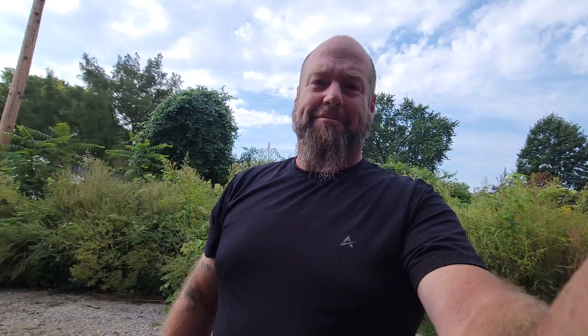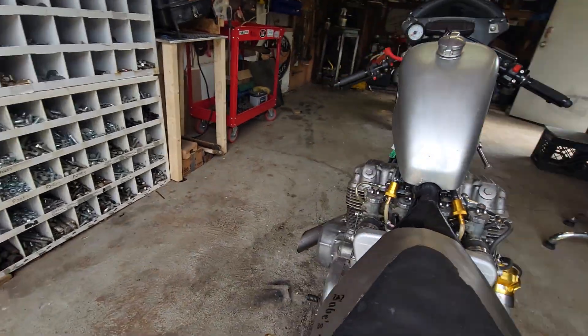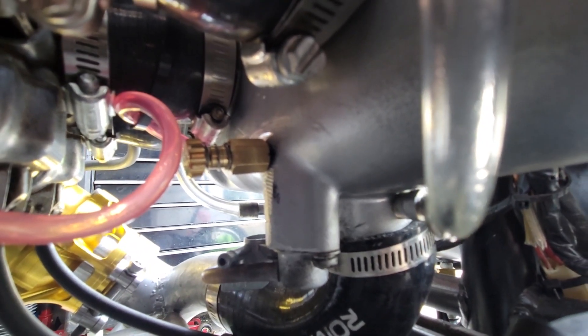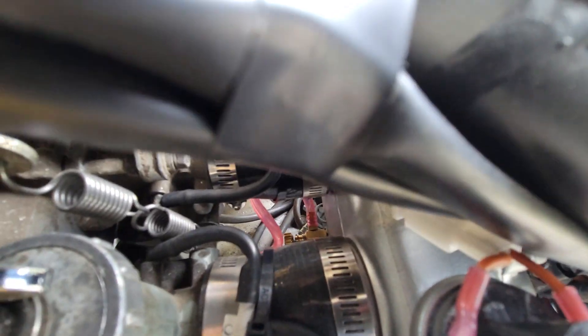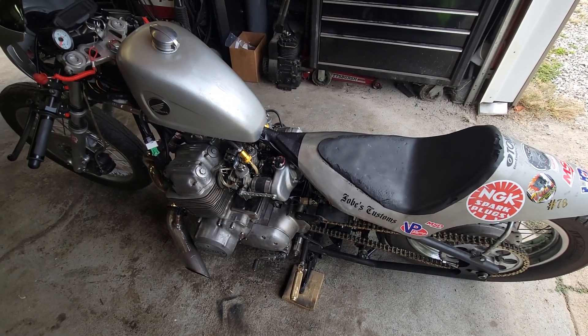This thing sure makes me happy. We're on it — it's about time to get this thing sending. Full send, full zoot, full boost. One more dyno hit of course. Still trying to figure out the high-end boost — it's still wanting to go a bit lean. That's the other new item: the adjustable Vito's power jet — it's tucked in down there. See the pink line? I can actually get to it while I'm on the bike, so it is fully adjustable. The pink line carries fuel over to the adjustable Vito's power jet. Once the boost comes on, Vito's provides a good gulp of fuel into the intake plenum, right down there in the middle. Hopefully once the boost comes on, we can get that tuned in on the dyno with a nice heavy load.